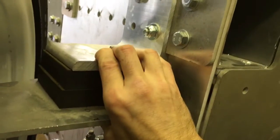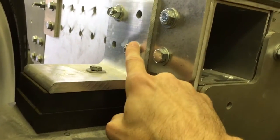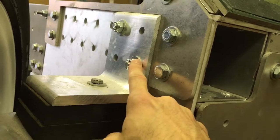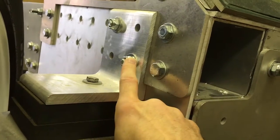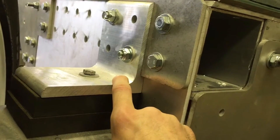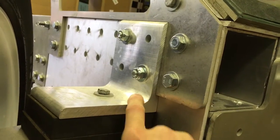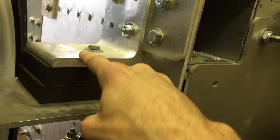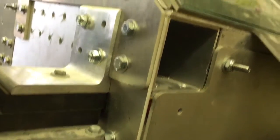Now to get these attached, you may need to clamp them together to pinch these bushing blocks into their preload so that these bolts line up. You can use either three-eighths bolts or metric ten-millimeter bolts — whichever is more easily available in your location. If you're using three-eighths imperial bolts, you'll want grade eight bolts. If you're using metric bolts, you'll want a higher grade, but they're also thick enough that even the low-grade metric bolts are within the same tensile strength range. So now you have your A-arms attached with your bushing blocks and your top mounts.